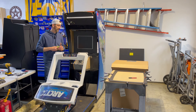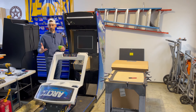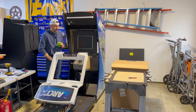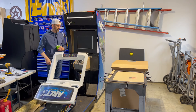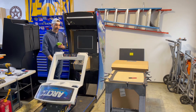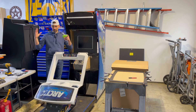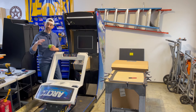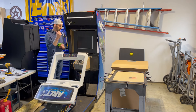We're going to go ahead and do that. With Unico monitors — these Phoenix line monitors — we've had kind of mixed results. The first 26-inch I put in the Cruisin' World cabinet: the picture looked great but there was a cropping issue, we really lost some of the image on the bottom and couldn't fix that. On the 19-inch side, we put that in the SCI cabinet — the monitor displayed the image properly but the brightness was way out of whack, so we had to put some inline resistors in, which fixed the problem, though it still wasn't the best picture overall.